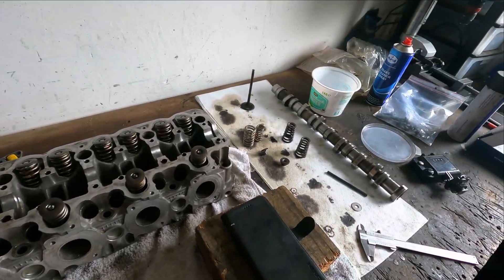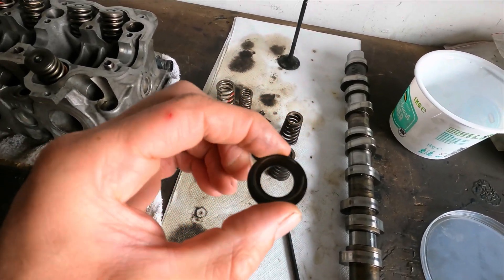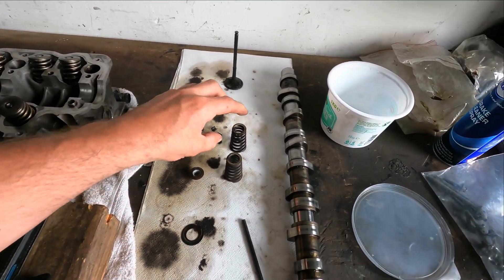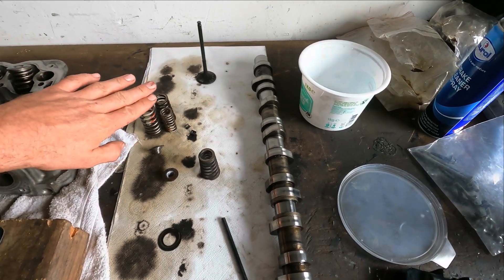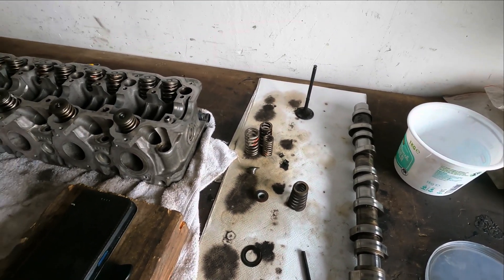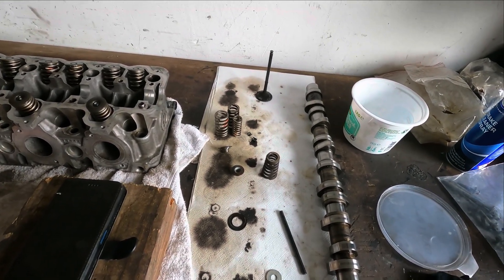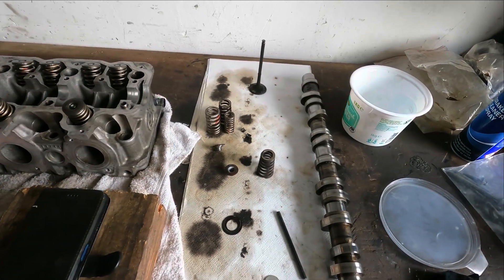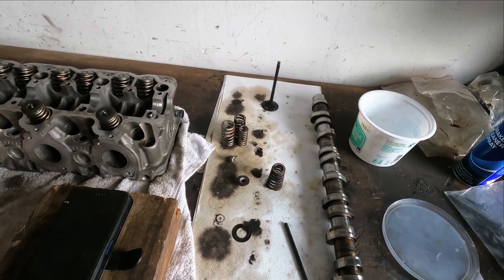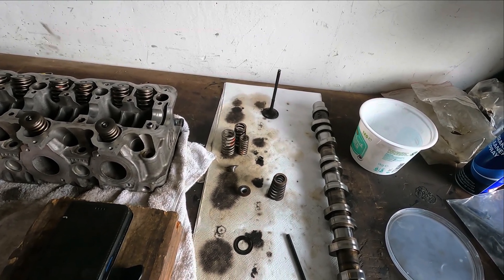The original M113 with normal heads has a very small hardened plate — that's half a millimeter, so half the dimension. These springs at normal height are almost the same level. When installed it's 38.8 millimeters. I found a lot of info on CATCAMS — they have data on the original M113 960 cams, spring pressures, installed spring pressure, and maximum lift. Out of my head, maximum lift is about 9.6 millimeters on the valve.